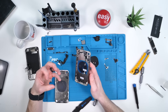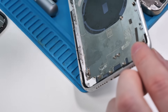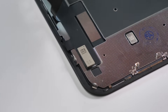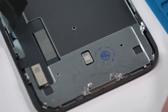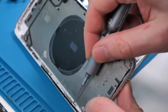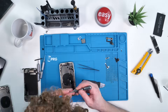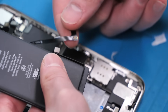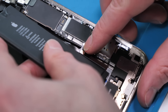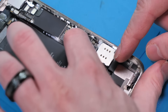So we're pretty much all ready to build this up. But before we do, we have to transfer over these little clips that hold the screen in place — it's like an extra layer of support. You can see on the screen you have these tabs, and these little screws where the display connects to the back plate also hold in the screen when you click it in — that's basically where the crunch sound comes from. We're going to transfer all these over. The reassembly process was pretty standard for an iPhone XR. We took all the parts and placed them in the new housing, but when it came to the battery, things got a little bit strange. It was really awkward trying to connect the battery to the tag-on flex and then the tag-on flex to the motherboard. It took a lot of disconnecting and reconnecting, but we managed.